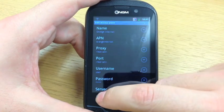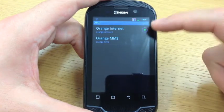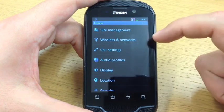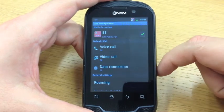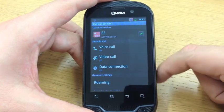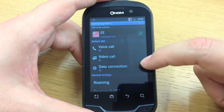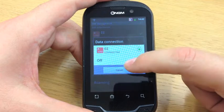What we want to do is press this small square with a triangle in the corner, and we can save any settings when they're made. You'll see that this is the active APN. Now if we press back until we get to the main settings menu, and then go up to SIM management, this is where you can manage which one of your two SIM cards handles each sort of responsibility for the handset — i.e. voice calls, video calls, and of course the data connection. We've only got one SIM in, so it's only showing the EE or Orange SIM at the top, and the mobile number for that, and then we've got data connection defined as being the EE SIM card — that's a little green dot in the circle.